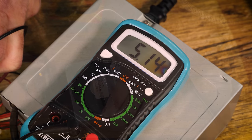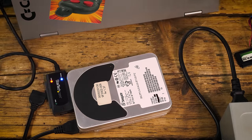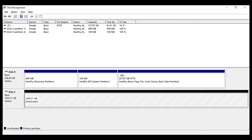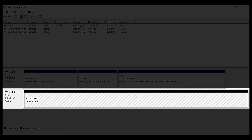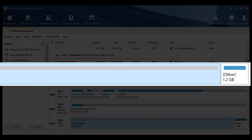Next I wanted to check out the hard disk, so I did that with an IDE to USB cable and popped it into my laptop. I would expect any partitions on this disk to use the FAT32 file system, so as soon as I plug it in it should just pop up in Explorer and be completely readable. But the disk performed miracles — it didn't work, and showed up as a one terabyte drive in Windows disk management with no partitions. I fired up Mini Tool Partition Wizard, which shows disk three as a terabyte again, but also shows 1.2 gigabytes allocated as 'other' — more along the size you'd expect — but it wasn't accessible. In situations where a disk doesn't just pop up and work, Windows has its limits, so sometimes you've just got to fire up your Linux live CD to get things done.